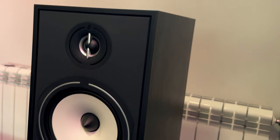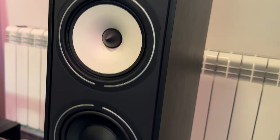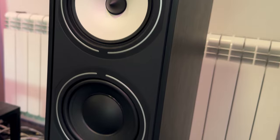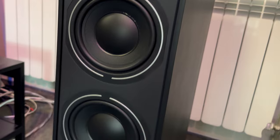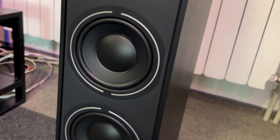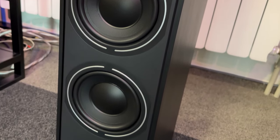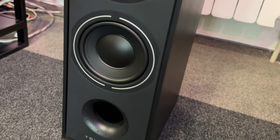For the bass drivers, this model — the BR-09 — has three, each 165mm. The goal was to deliver rich and dynamic sound in the low frequencies while not introducing any unwanted distortions. To achieve this, Triangle opted for fiberglass membranes, as their rigidity emphasizes strong impact reproduction. They have a single magnet on one side of the voice coil, unlike the Esprit EZ which uses two magnets.